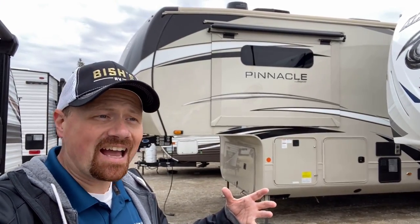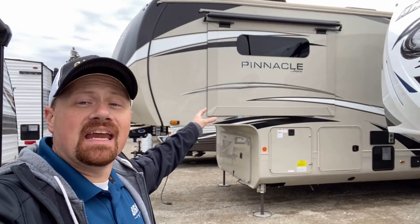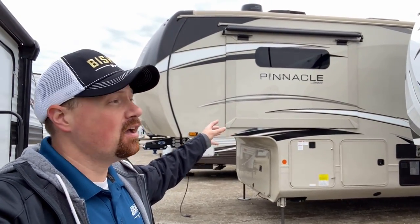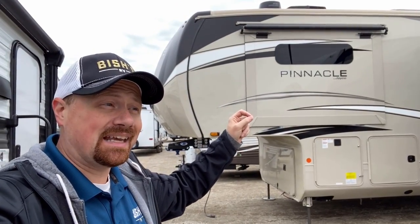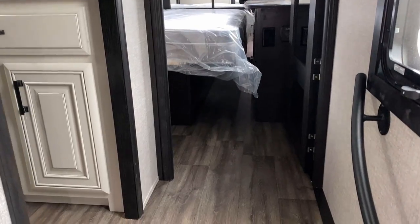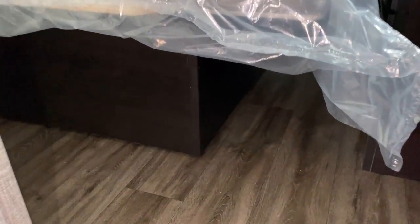Needing to occupy a sofa and dinette slide on a travel stop is questionable, but needing to access and use a bed for an overnight stayover is very common in a lot of bigger fifth wheels. There are some specific things you want to look for here. Sometimes under a bed slide you can see things like a couple of casters or wheels — that means the inside edge of the bed is supported, which is what you need. Sometimes, though, like in the case of this RV, you can't see that. So what can you do?